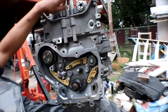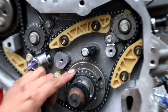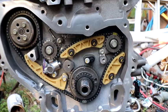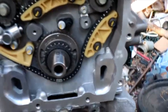Now we'll grab onto these cams and the secondary sprocket and set that timing up. I'm back here on another day of setting the timing for the Cobalt — I went out of daylight on the first day before doing the second chain. Today I should get through with that, which will consist of setting the timing for the cams together with the crankshaft and finalizing it. This is how the first timing chain is set and now I just need to connect that second sprocket.